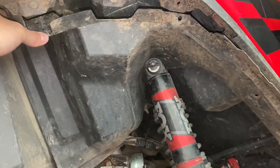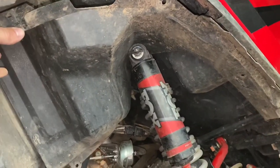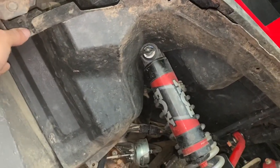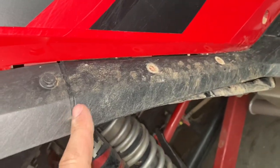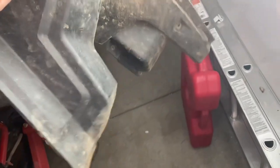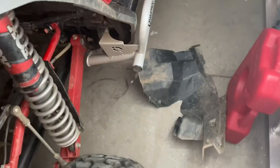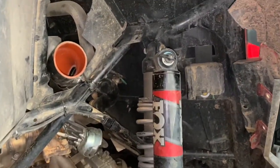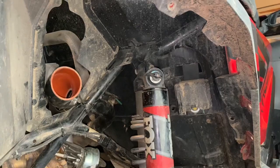We're here behind the rear passenger seat above the rear tire. We're going to remove this plastic piece. You'll have nine push rivets underneath and then two push rivets right below the joint that you'll need to remove — nine underneath, two on top, for a total of 11. It's honestly kind of a pain to take out, and that's another reason I want to move the filter. Not only is it a dust vacuum down here, but it's a pain to access and clean.